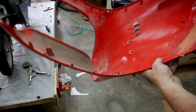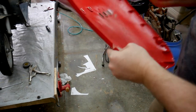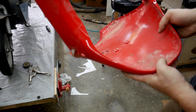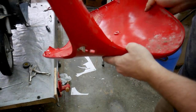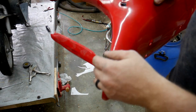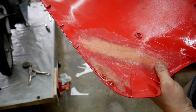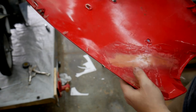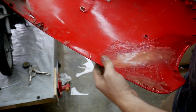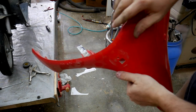I'm used to working on Honda Sprees and Honda C70 Passports. The plastic they use on the Sprees and Passports is more of a nylon or polypropylene — it's very flexible and has its pros and cons. Since it's very flexible it can warp easier, but it is not prone to breakage. This fairing is some type of polystyrene or maybe white ABS plastic, which is much more rigid. It's not going to warp on you, but it's definitely going to crack and break.